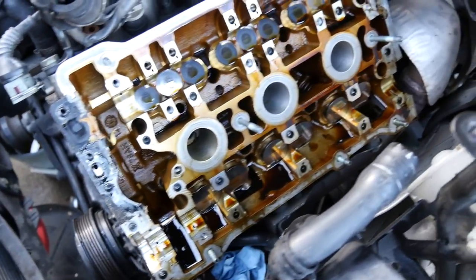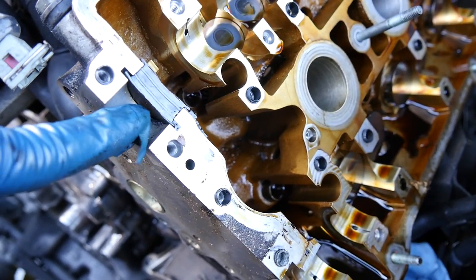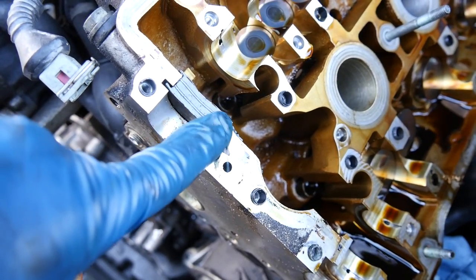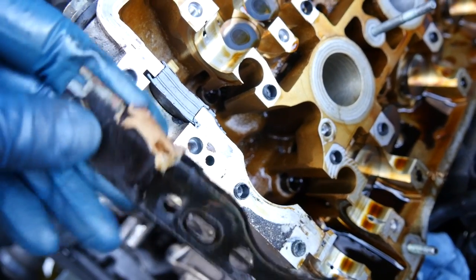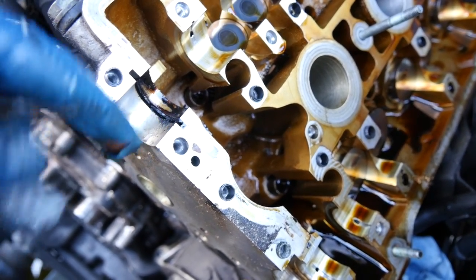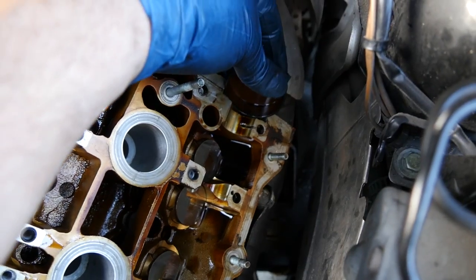All right, so here's a close look at our cylinder head without our camshafts. Here's a look at our camshaft chain tensioner gasket. This goes on there like this. There's our half moon seal. This is a rubber seal, and usually there's some RTV at the end of it where it's uneven, but there isn't any on this one. However, there's some RTV up top, but there's a bunch of RTV underneath it that we need to clean now. And the camshaft cap I was telling you about goes right here on the exhaust cam at the end of it, goes in like that.